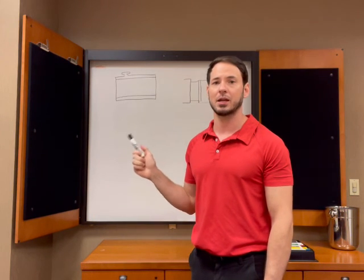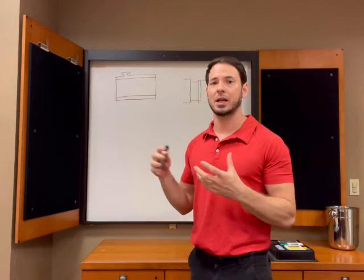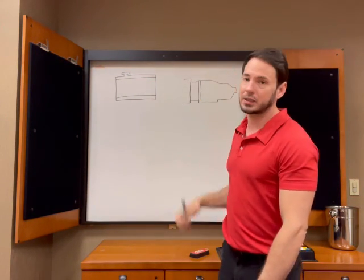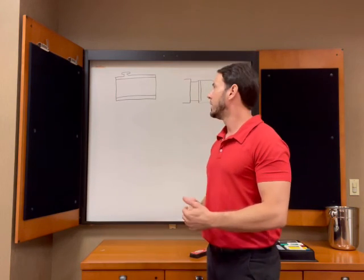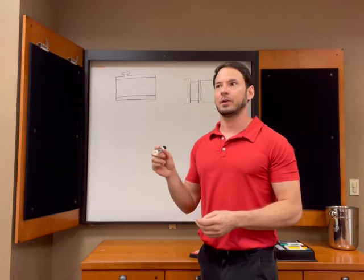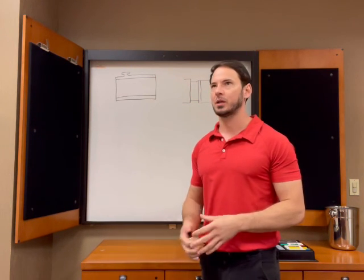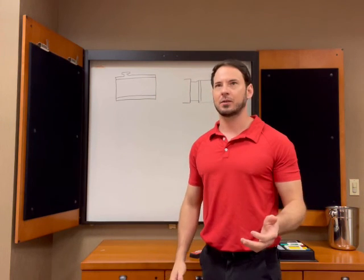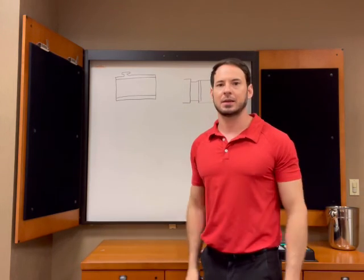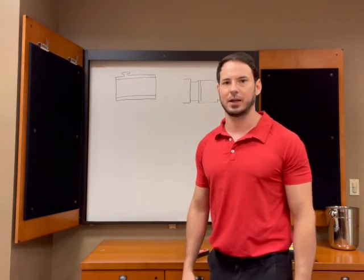There's been a lot of advances made in rubber since the SVX was built, as far as seals, both internal in the transmission and your external seals, especially the torque converter seal right here, can be really nasty on these if it gets hot. So for that reason, I don't want my ATF over 220, 230 if I can help it. Now, if I was measuring my transmission fluid correctly and it got up to 230 because something weird was happening, you know, maybe I went up a huge hill, the AC's on full blast, I've got four people and luggage in the car, and it's 110 degrees outside, that's fine. That's not going to hurt anything. The fluid will be fine, the transmission's going to be fine, everything's going to be fine, no problem.